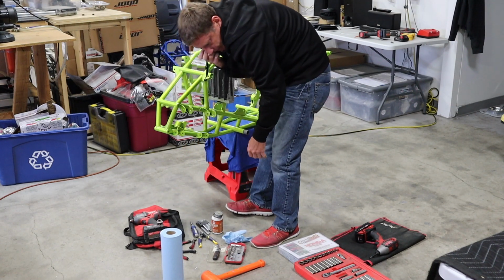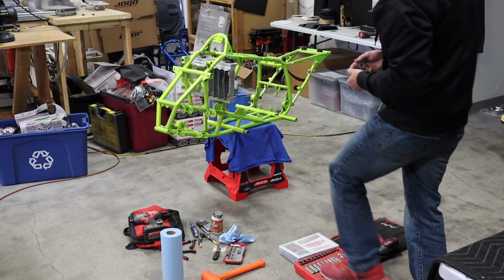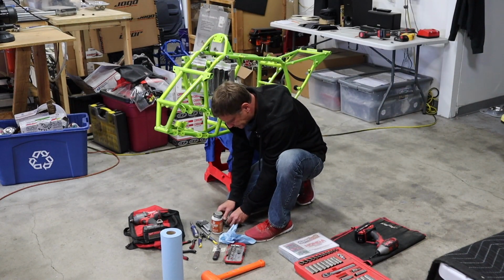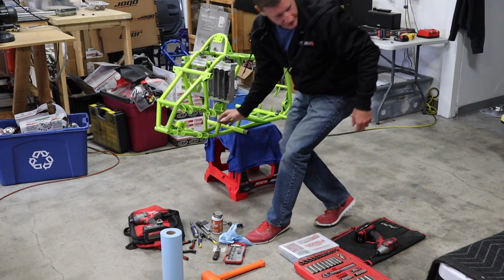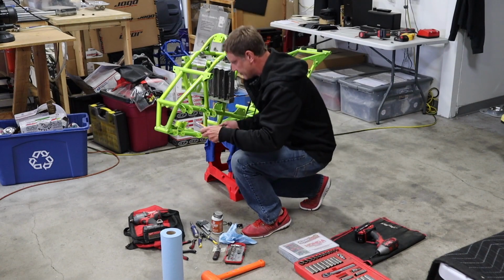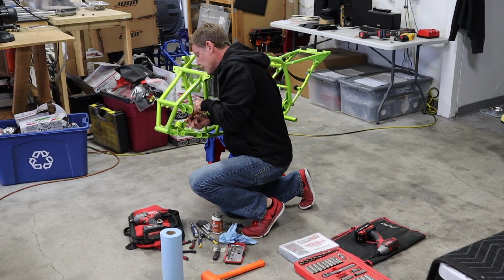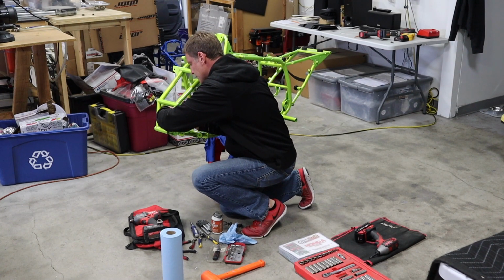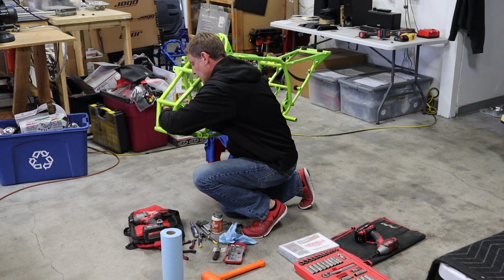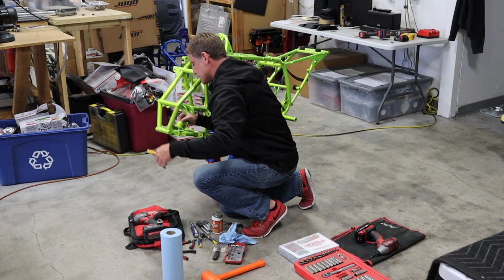So when you have an empty cup, normally I use all new stuff, but the bearing in this case was still in good shape. So you've got your steering stem bearing. You're going to drop that in, and sometimes you're going to get some powder. That's another good thing to have, a utility knife of some sort. You're going to get some powder buildup, even though they tape it off. There's always some around there that's going to hold you up. So I just run the razor around that powder, shave it off, and that's going to make the bearing drop in a little bit easier. You want to try to get in there as straight as possible.